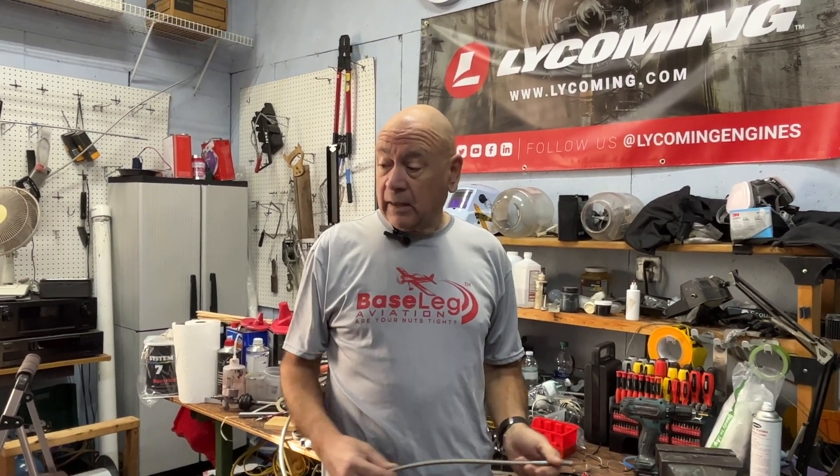Hi everyone, we're back. One of the things I'm always talking about with regards to our aircraft that we maintain is the life of the hoses and how they need to be checked regularly. Your typical rubber hose, mil spec MIL-6000 hoses, have a life expectancy of about eight years — the shelf life is eight years — so somewhere around eight years you ought to be replacing those things.